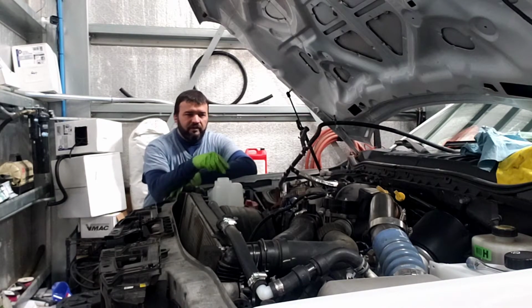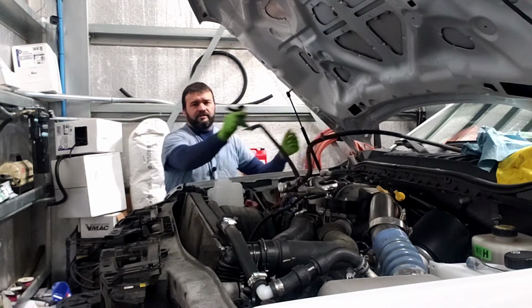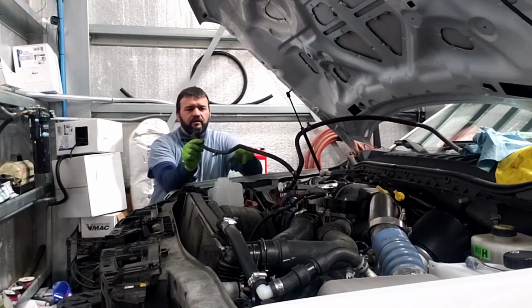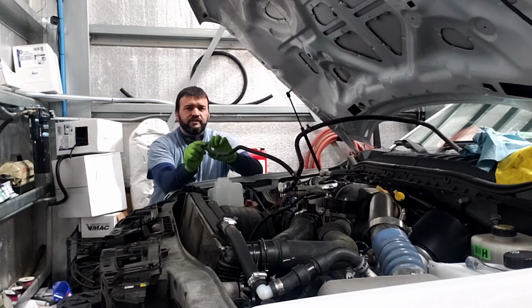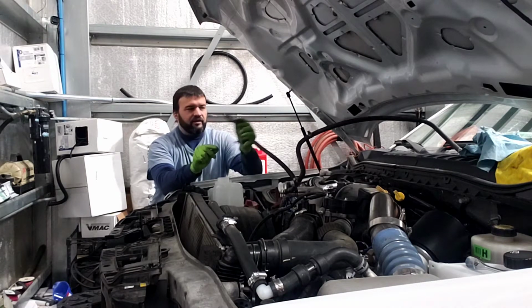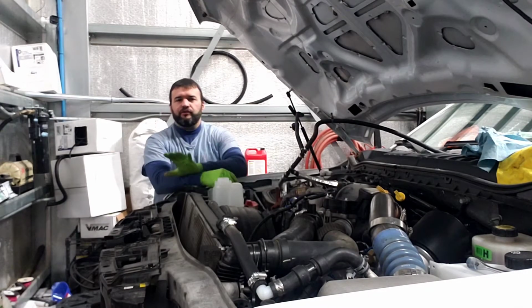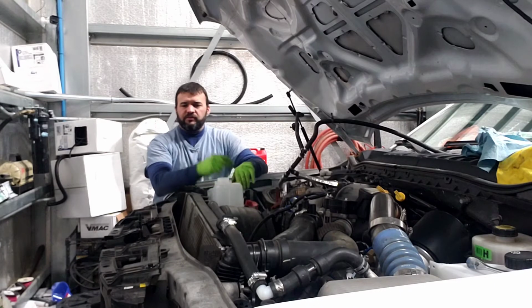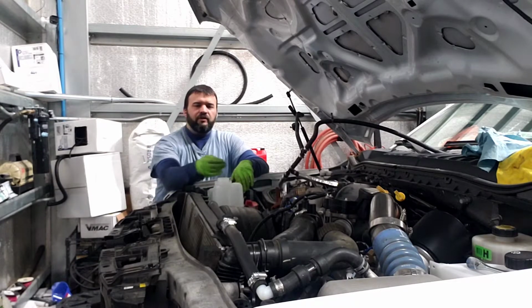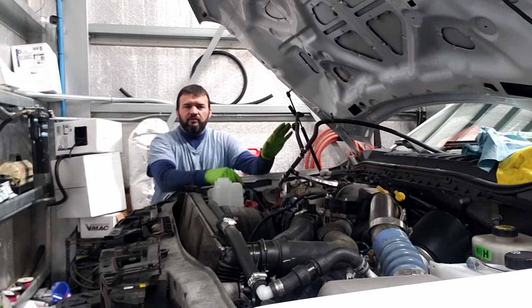Once we get done with that, we're going to be modifying these little coolant lines here. There's two different T's in there. One is an orifice T and the other one's a standard T. We will be relocating them in a way that all this fits after we've modified the cooling system. This is the last piece that has to be modified, and it's done after you put everything else on the truck. So you can go ahead and put your radiator cover on, you can go ahead and put your coolant reservoir back in, etc. So once all that's in, truck's buttoned up, then you're going to modify these.